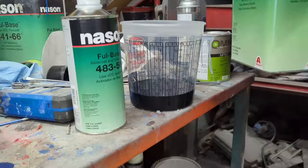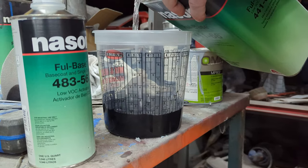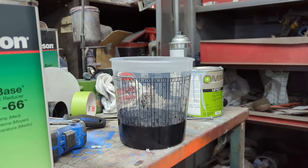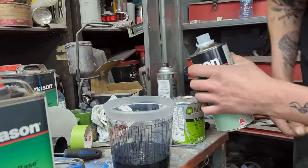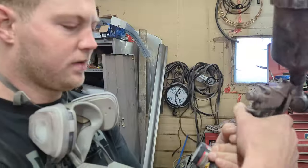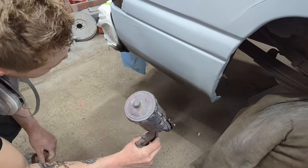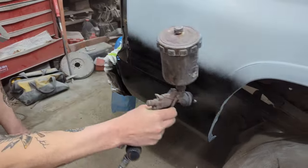So we brought the paint to two on the mixing cup, then the reducer, and now for the activator — these are about $140 now — and you bring that to two as well. Stir it up and it's ready to spray. At 35 PSI with the flow down, just give it a little test spray. See how nicely it's an even mist — it's not blotchy.